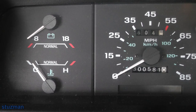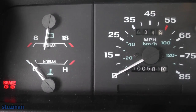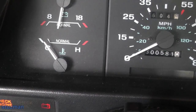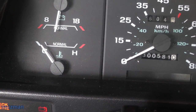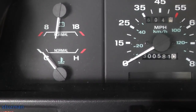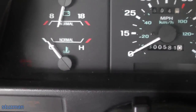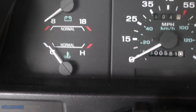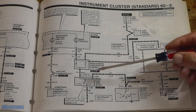We have the new brake fluid level sensor. There are latch tabs - flip them over so the terminals are on top, put it inside and push it in to lock it. Take the connector and slide it on, then push it in and it locks. To confirm everything is working: turn the switch to the on position, press the parking brake - brake indicator light comes on. Release it. Starting the engine and putting it in the start position, the light comes on momentarily and goes out. That all looks good.